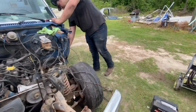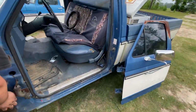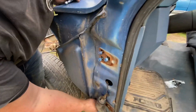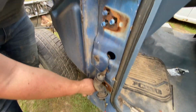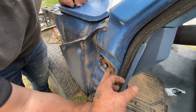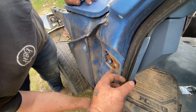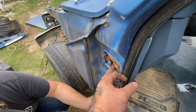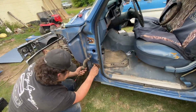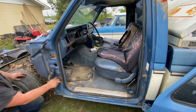Just a little bit of something we found that always helps out. Every time we pull doors off, and a lot of y'all know about it, but we run the bolts back in there, because it always seems these latches like to get rusted out, or definitely get some dirt and crap in them while you're doing the builds. So we just run them in, try to keep them clean. Probably pointless information for y'all, but I just wanted to share it.